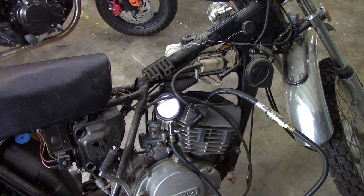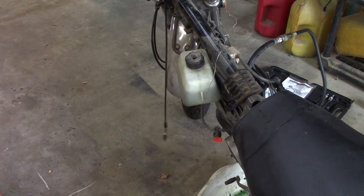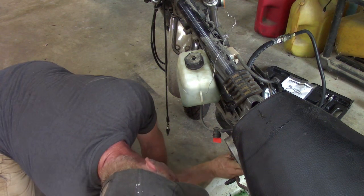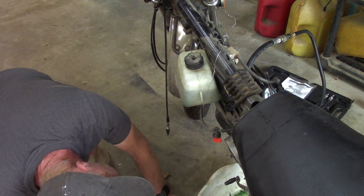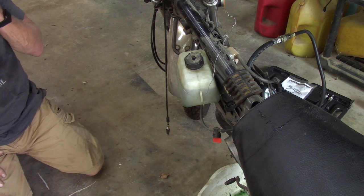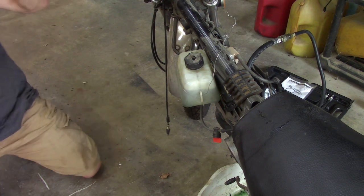there is one thing that I may end up checking. You remember in that previous video, we put that new crank seal in, and I did take this thing in, and I've noticed something. I can't show you right now because you're on the tripod. But I'm seeing two-stroke oil in there from the oil pump. I don't know if it was just residual and I had the bike leaned the other way, but I'm going to let this sit. I may end up having to take this magneto back off and double check that seal, but it looked like it went in there just fine. That's the only thing that's changed, and that is one thing that could definitely cause a problem. If that seal did not seat properly and it's trying to suck air into that crank seal, that could do that.